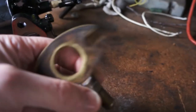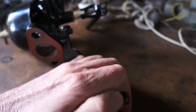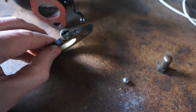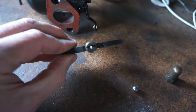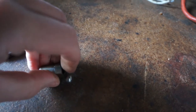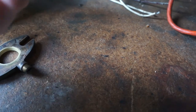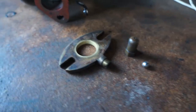I'll just open it up and show you the steel ball — it's just a ball bearing. You can see straight through there. The ball sits in this little brass piece here. As the vacuum increases, the ball rises and it admits air.